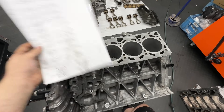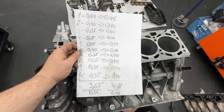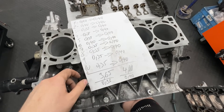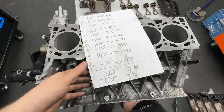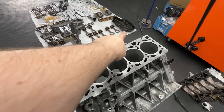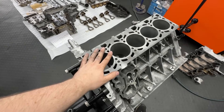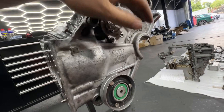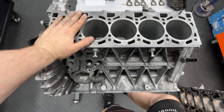Okay guys, so we are done with the measuring - 10 cylinders, and literally they are all in spec as they should be. We don't have to adjust anything, which is fine. Also, very important calculations: if you add all these numbers together you get 3.65mm. Divide it by 10 because we've got 10 cylinders and you get an average of 0.36mm, which is absolutely irrelevant - but yeah, I'm happy with it. We've marked all the pistons as to which one was measured in which bore, and all the piston rings are on there already, so we can continue putting the pistons into the block.